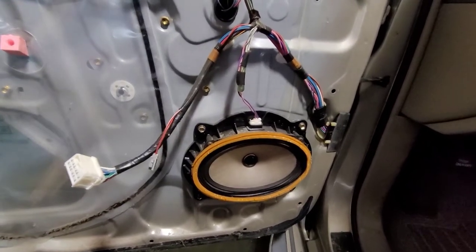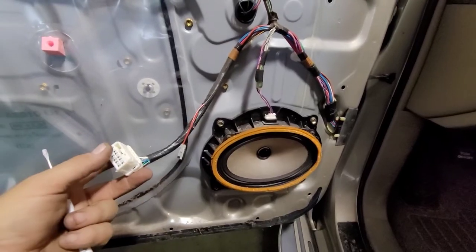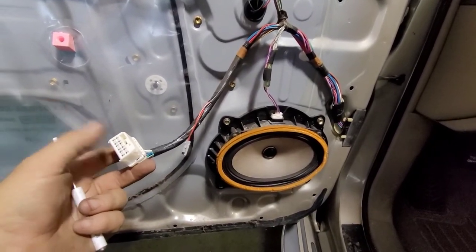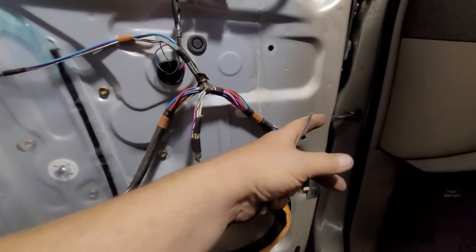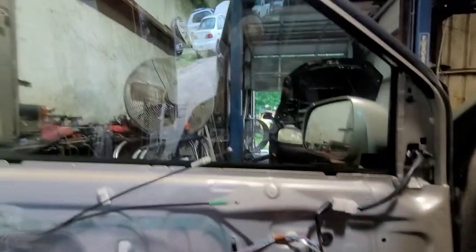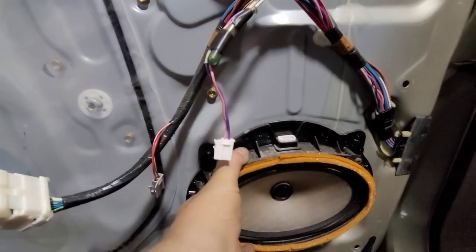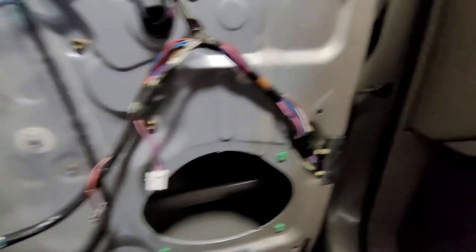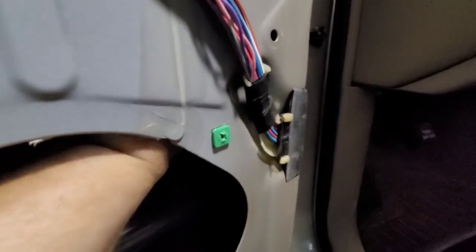So now with the switch panel out of the way, it looks like I've got two screws here, two Phillips heads. I can take those out and get this cut piece out. It feels like there's a screw underneath this going in that way, so let me get this off and see what's in there. All right, screws are out - that just lifts up. And as I thought, there's a screw in the center there. With that out and the panel out, this thing should just lift up and come out.